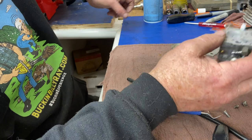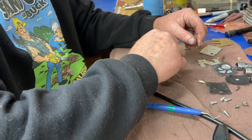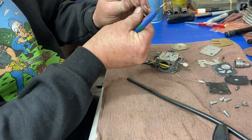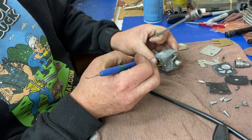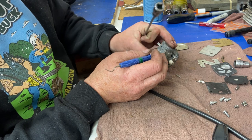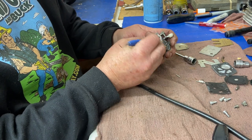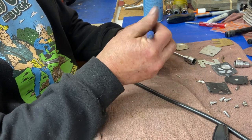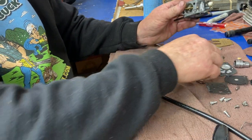Let's get our screen back in. You can use an Allen wrench that's almost the size of the hole and just push it down nice and even. Get it down in there so the little hole on the side where the fuel comes in isn't obstructed. Get that back in there and we're going to put the fuel pump side back together now.